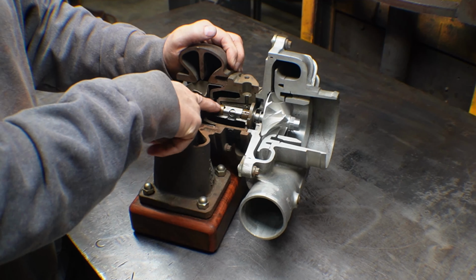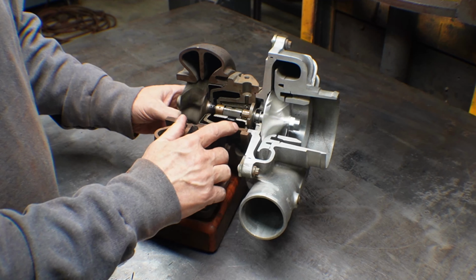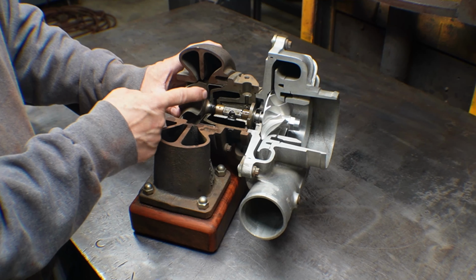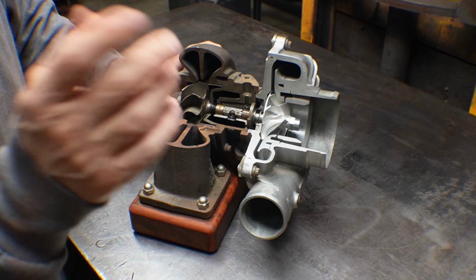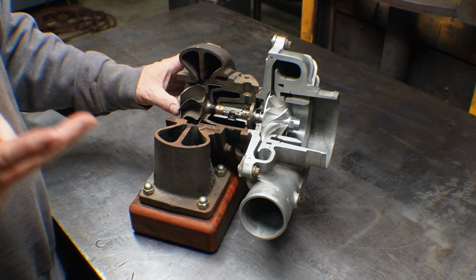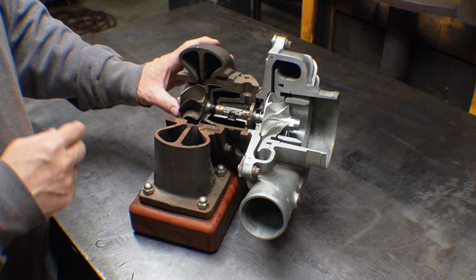These little brass-colored pieces are bearings, and they're what are called full floating bearings. You can see this one here is kind of spinning. But when this is in a vehicle and not full of dust and WD-40, let's say this shaft is spinning 100,000 RPM, this bearing here will be spinning 50,000 RPM or so, plus or minus 10,000. So it's a double bearing system. The relative motion isn't between one shaft and a housing, it's between the bearings. That does two things for you. One, it reduces the losses in the bearing because the shearing is happening half as much, but twice.